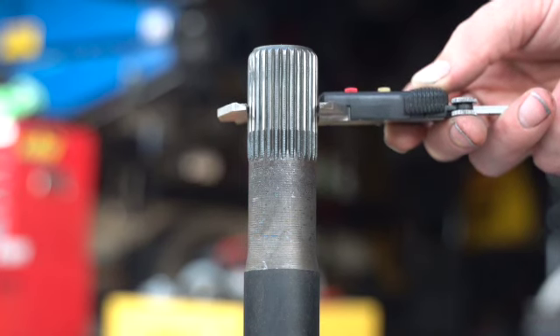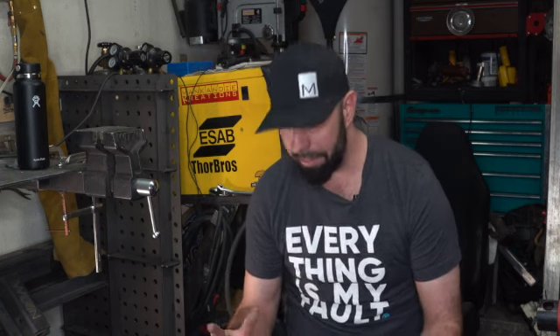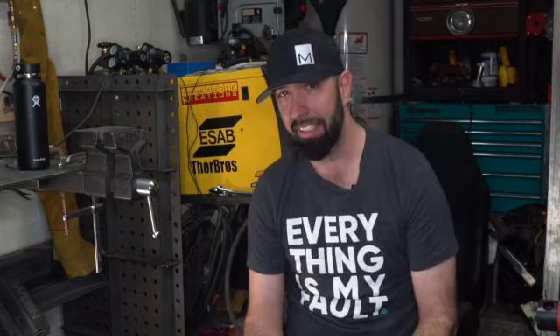If you want way more, here's the next thing you need to know. If you use a caliper, or even your fingers, you'll find that the splines themselves are raised higher than the shaft just adjacent to them. That's because the manufacturer used heat and pressure to form the splines — they started with one diameter, and when pressing in the valleys of the splines, the peaks rose. The machine shop, on the other hand, will be cutting the splines, which means they need to start with material that's already at or greater than the finished diameter of the splines. That means this section of the shaft is unusable. In order to successfully re-spline the Mighty Max axle, we would have to move beyond this narrow section where the diameter becomes a little bigger, which is about 3.5 inches from the end. So the minimum we can shorten a Mighty Max axle is 3.5 inches.